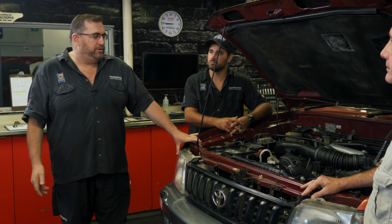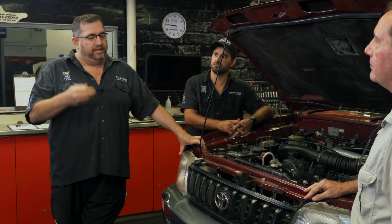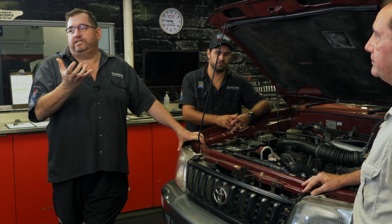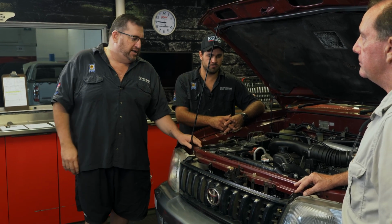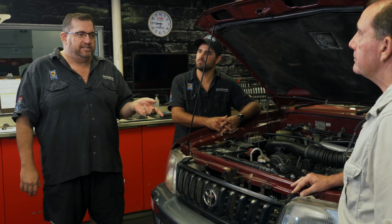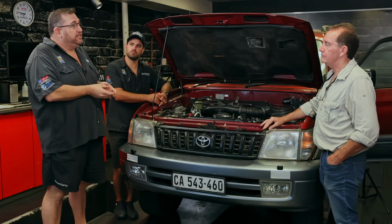That's also a safety point, because what kills a diesel is the injectors when they're basically worn and they spray in the wrong pattern and too much fuel. That just chases the exhaust gas temperature up. And once that happens, it creates a lot of problems. I know there was a range of these vehicles back in the day. They used to crack the cylinder heads, and that's obviously because the exhaust port's designed slightly too small.